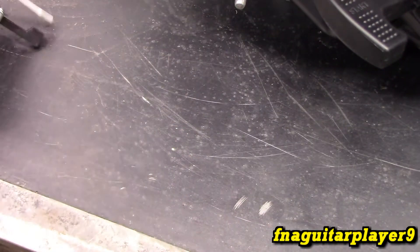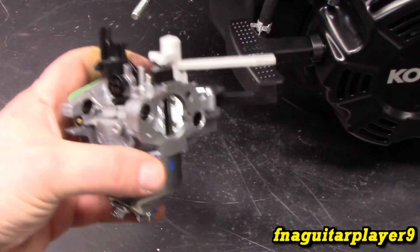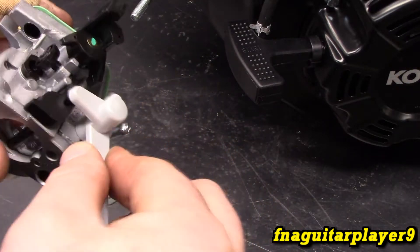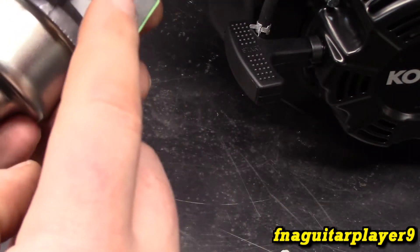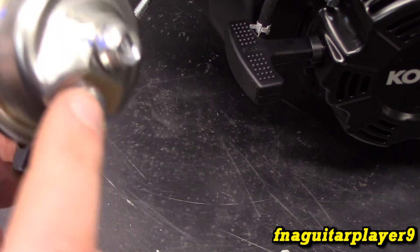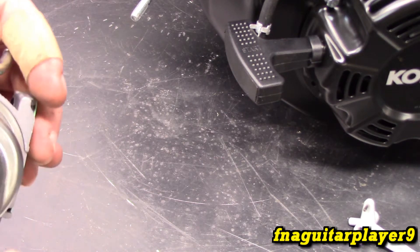You also have this plastic block that goes onto the intake — there's probably a gasket or O-ring type seal behind there. If you need to remove the choke lever to work on it, it just comes off like that. Your fuel shut-off valve is built into this, but you can take it apart to clean it if you're not getting fuel through to the bowl. This carburetor also has a drain screw. You can see these witness marks — if the paint is worn off or it's in a different spot, that means this carburetor has been apart, which obviously voids the warranty on a brand new engine.